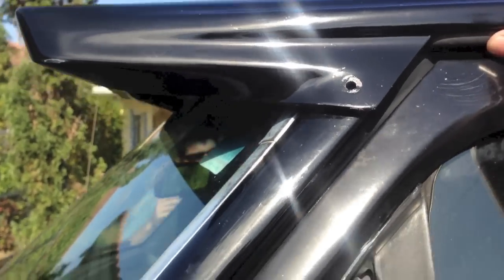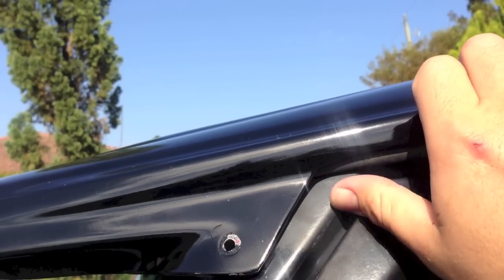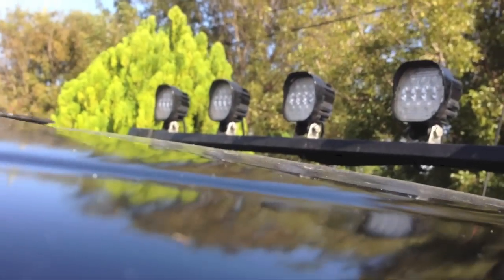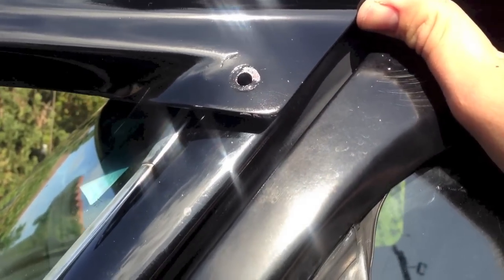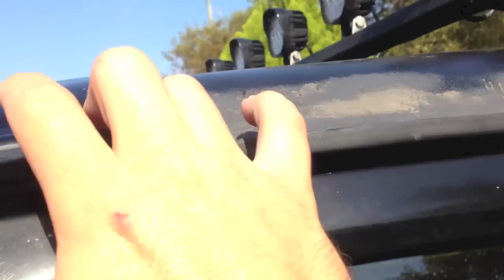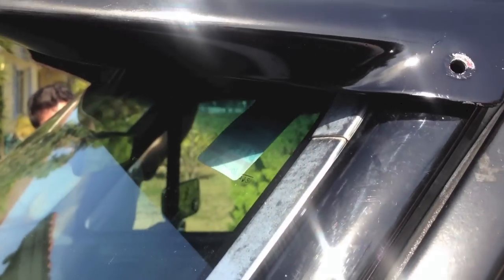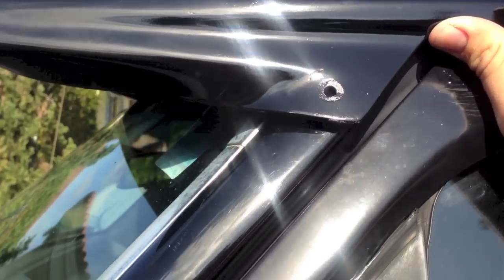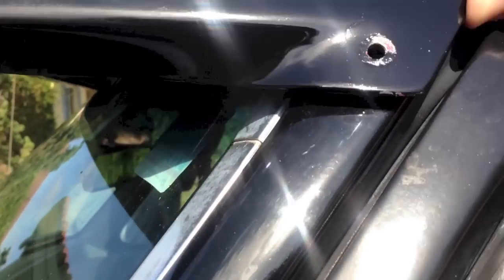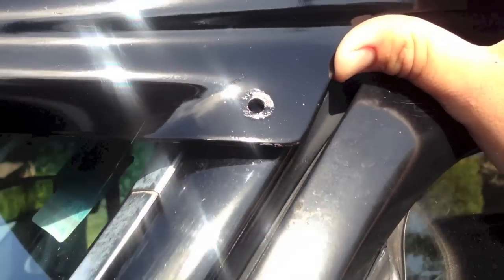You can see how I mounted these holes and where I placed them. Right where the A-post comes up and moves forward, you gotta line up the visor right in line with it. Your rain gutter gets covered by this thing — that's your rain gutter right here — and this lines up with it. I recommend at minimum two people to help you mount this, because you do have to measure it quite a few times to get all the angles perfect. Three people would be best so two can hold it while you look, measure, and re-measure, because you only get pretty much one shot.